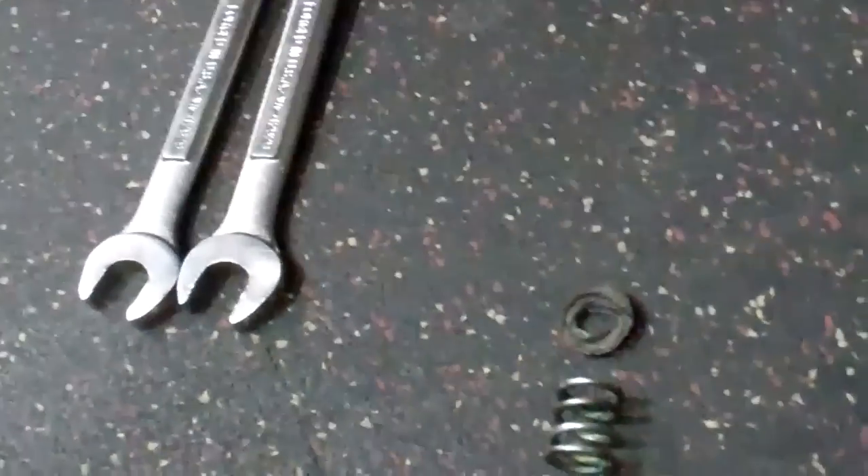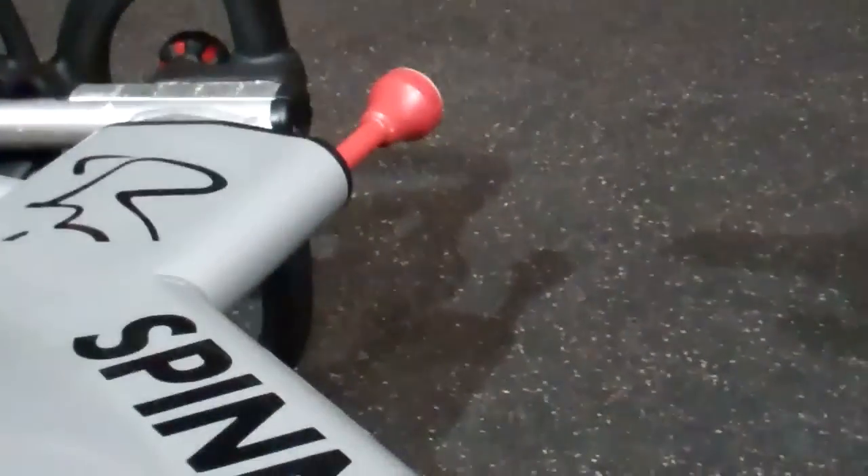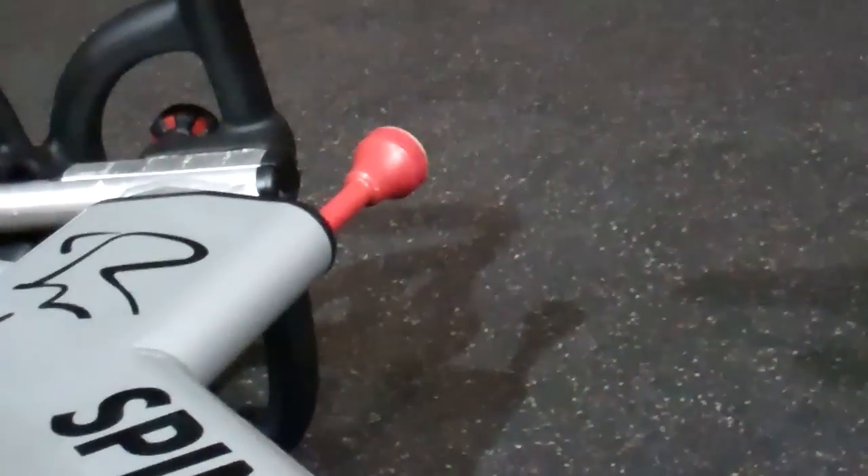When we send this stuff, the hardware will be greased so you don't have to grease anything. Once you get the rod assembled, turn the knob counterclockwise to bring the acorn nuts as high up as possible so you have plenty of clearance to reattach the leaf spring. Then position the pad so that it contacts the flywheel just under the acorn nut, and attach the two 10-millimeter nuts.